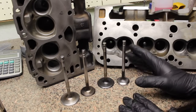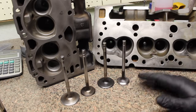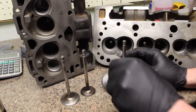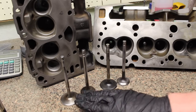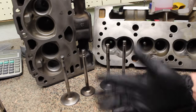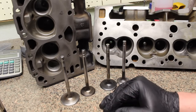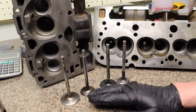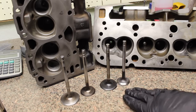The old-school thing to do on a set of small block heads — or most heads — is to upgrade the valve size. The stock valve size on a Vortec head is 1.94-inch intake and 1.5-inch exhaust. Just like on my last video covering the camel hump heads, a real common upgrade was to go to a 2.02 intake and a 1.6 exhaust. This worked really well on the camel hump heads, but the myth on the internet is it's not worth doing on the Vortec heads — and I couldn't find any proof or testing to show me why.